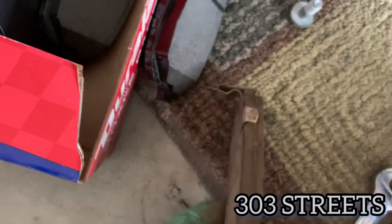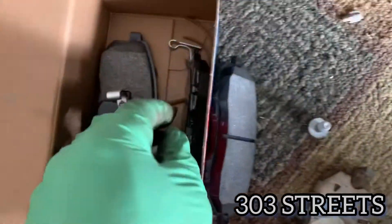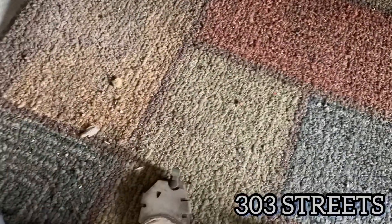This one actually does have a tab, so we'll have to make sure that the ones with the tabs — you can see this one has a tab — I'll match up those ones with that. Either way, now that we have these out, once you get your pads out you can throw the new one in after you clean the rotor.